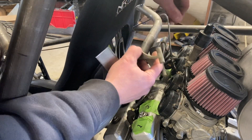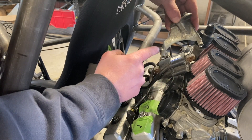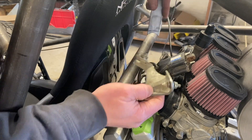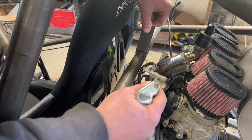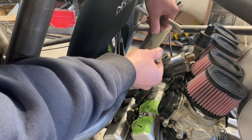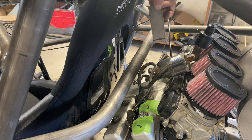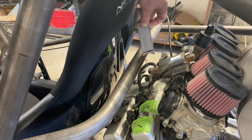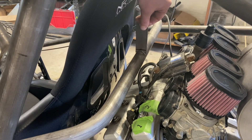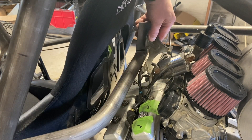I had this coil bracket from a different build. It basically holds two coils, one on either side, and the grounding point becomes the mount — or it comes with an external ground in case you're mounting it to aluminum. I'm going to put a simple mount right on the center of the harness bar so it doesn't interfere with our harness and we can still get the engine in and out. Now a hot tip: if you're mounting something at an angle to round bar, it's still going to be cut to an arc with a hole saw, but you just use a bigger hole saw and clock it. This is inch-and-a-quarter for the harness bar; I cut with an inch-and-a-half hole saw and when you twist it, it tightens up and gets the angle perfect for our coils.